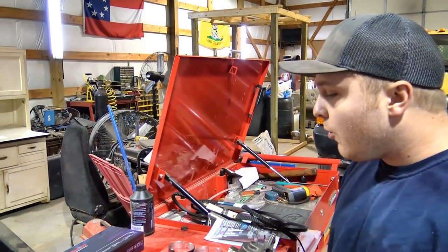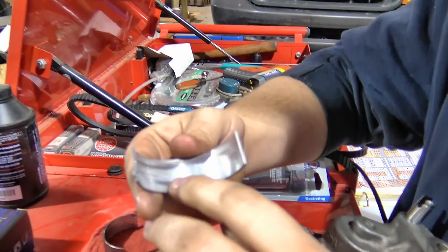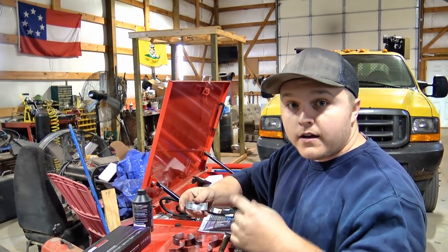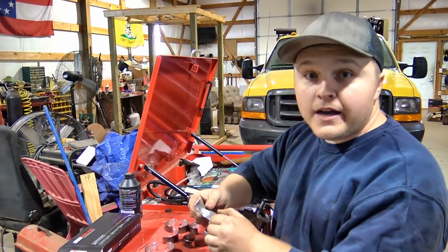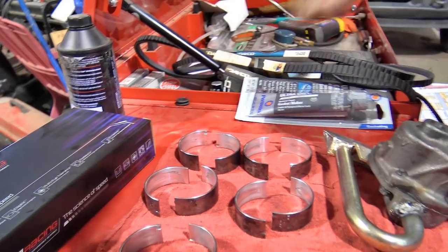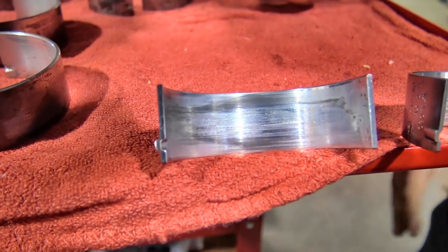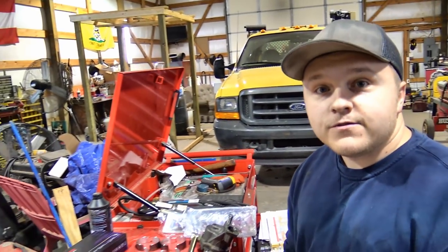Now the rod bearings were a little different story. I pulled the center rod bearings off and found some wear — almost looks like little scratches or gouge marks. We don't want that because it could actually lock the bearing up and spin the bearing while it's on the rod in the journal on the crankshaft, which could possibly mess up our crankshaft and our rod. Luckily we caught it before it had any major issues. I went and bought some new bearings. A brand new bearing has a very nice, smooth, shiny surface versus the gouged and scratched one. It's still not terrible, but while we already had the pan off we needed to replace it without worrying about the motor blowing.